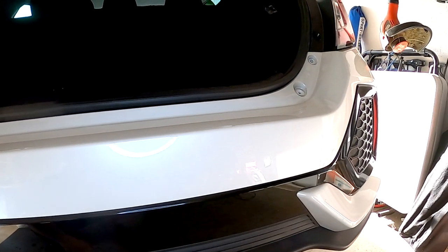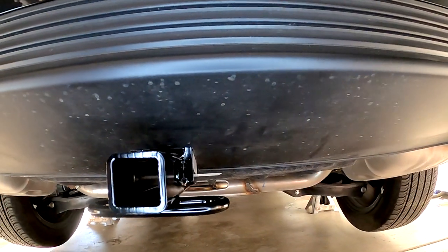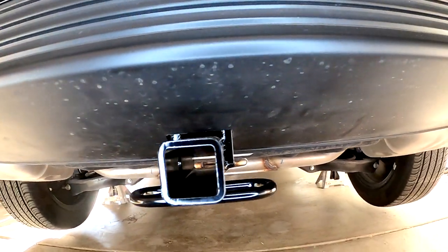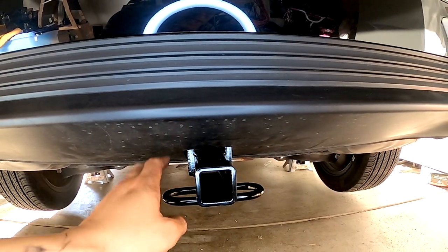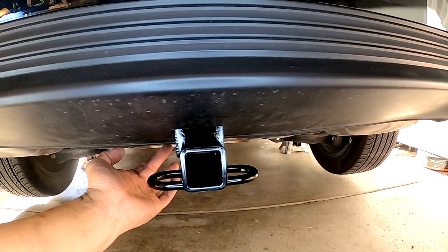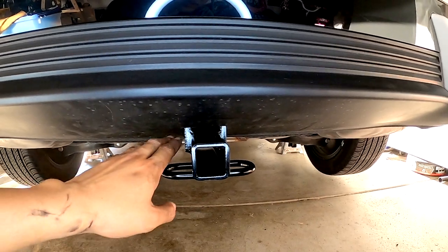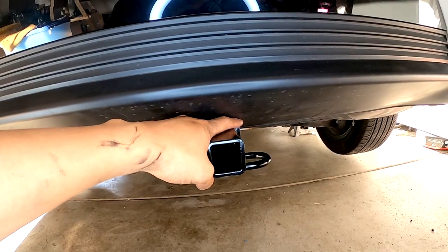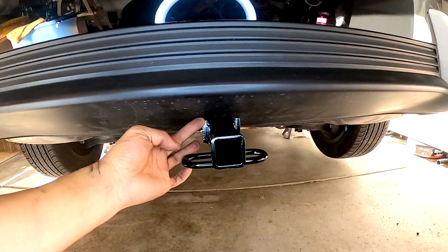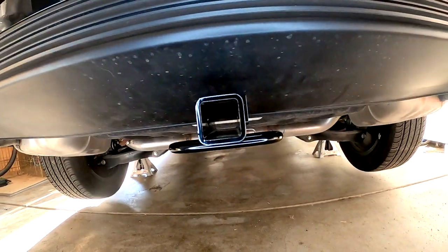And this is the moment of truth. I have my bumper just sitting on those little plastic hooks on the top. Wanted to check out how well my cut was on the bottom — and it's pinpoint precision, 100% accuracy. This is about two and a half inches across. I gave myself maybe about a sixteenth of an inch on each side, and from the very bottom lip I went three inches up. There's no need to make a gigantic hole — literally about 2.6 inches across, three inches out. That's all you need.